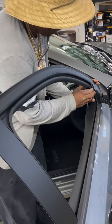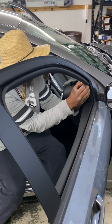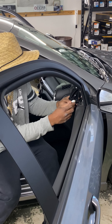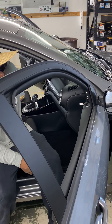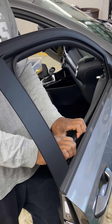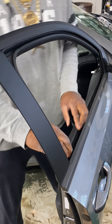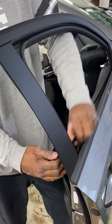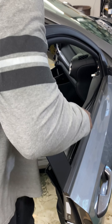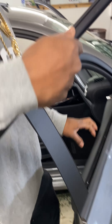The same way you took it out is the same way you put it back in. You just wet inside the seal and it should pop right back. The front one is a little bit difficult. You can use a panel popper, but you don't necessarily need it. Unplug the speaker. Pop up the back and just work your way down and it'll lift itself up. Right here is a little snap — once you take that snap out, that's all the hard work you got to do. And you're in the game.